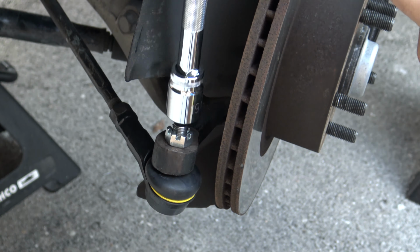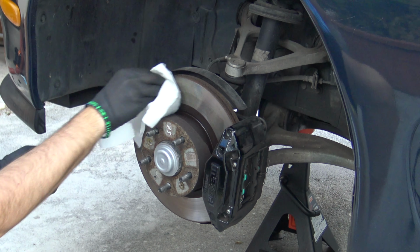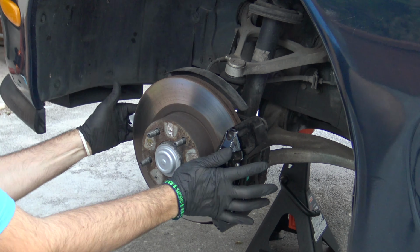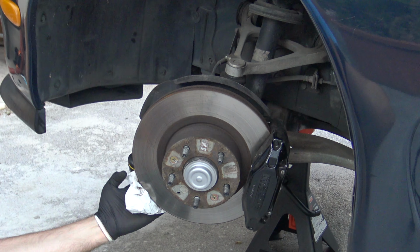The purpose is to leave it within its torque setting. The torque wrench is a professional precision instrument and I really don't recommend buying a cheap one. Make some turns full lock to be sure everything is working, and after a visual inspection clean the brake rotor on both sides with a brake cleaner. Cleaning the brake rotor is important since we used lubricant around it.